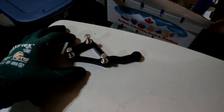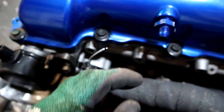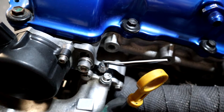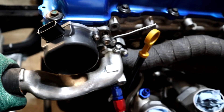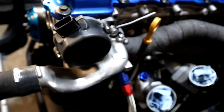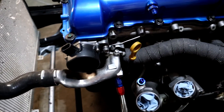The last thing now is the GK Tech coolant spacer, and we're going to install that right in here. Four screws is all it takes to install the spacer. It looks pretty nice and clean. I've got a 1/8th MPT sensor just as an example for the coolant right there, but I'm going to be switching to a completely different sensor that the Link ECU will be able to use. There's one more bolt hidden underneath, but that's all it takes, and it doesn't kink the hose too badly — I'll just move it around a bit to make sure it's nice and relaxed.